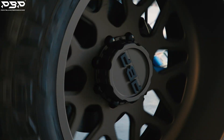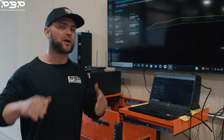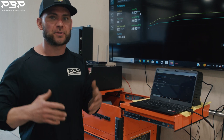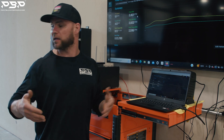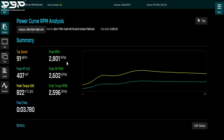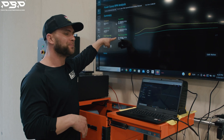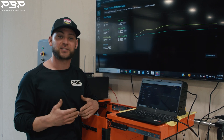Our 5th Gen powered by the CP3 high-volume package is singing with that 67-millimeter turbocharger — it sounds good and it's making power. But is it actually making power? That's something we have to verify on the dyno. What did this truck end up making? We made 407 wheel horsepower and 822 foot-pounds of torque. That's not very good numbers for what's been done to the truck. Looking at the dyno graph, I stopped this run at 2,800 RPM — I had a gut feel and said stop, because this thing wasn't going to make any more power. We made peak horsepower and peak torque at 2,500 and 2,600 RPMs — we should have made it all the way to 3,000.